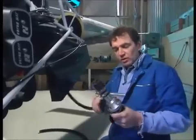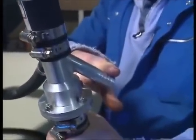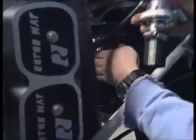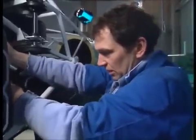I've connected some of the hoses to the thermostat housing — there's the two main ones, top and bottom, and then two other pipes come off it. This one is a bypass pipe for when the thermostat's closed, and this one will go to the oil heat exchanger. The whole unit nestles between the exhaust pipe on this side, the back of the engine, and in front of the radiator and the fan shroud.